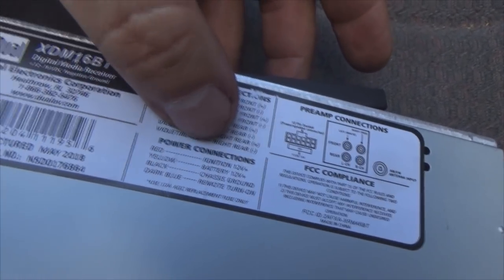Well, what I do oftentimes is, if I just want to be sitting, chilling, hanging out with people and turn the radio on just to jam a little bit, I don't want to have the key ignition on and have the whole Jeep powered up just to listen to the radio. So if you take that 12 volt ignition and run it to 12 volt hot all the time, then your radio has power all the time to be able to jam out and chill with your people, and not have the rest of your rig on.